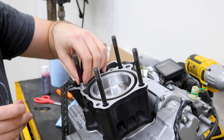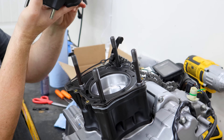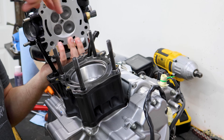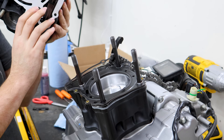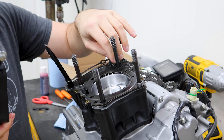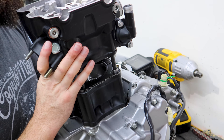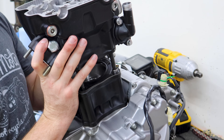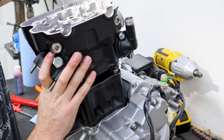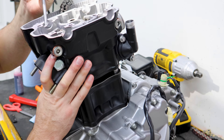Cylinder is in. Wipe off the excess oil, put in the dowels, and install the new head gasket from the big bore kit. Now I need to figure out the cam chain guide orientation — there's a little knob that needs to sit in a groove, and there's also a locating feature at the bottom; it basically acts as a wedge. This is one of those silly things you don't want to forget when assembling. I'll use a big flat head to press it into position and wrangle the guides into place.